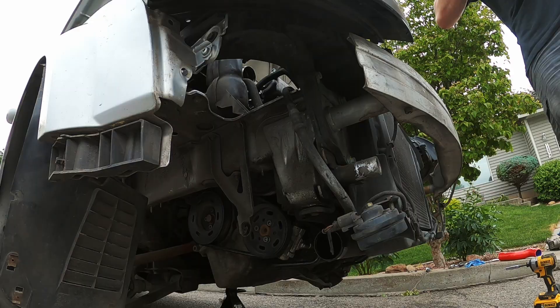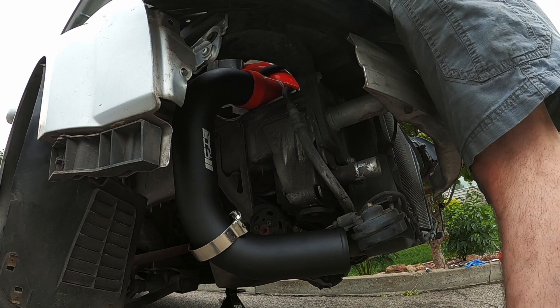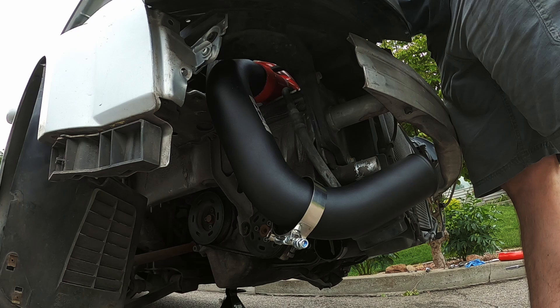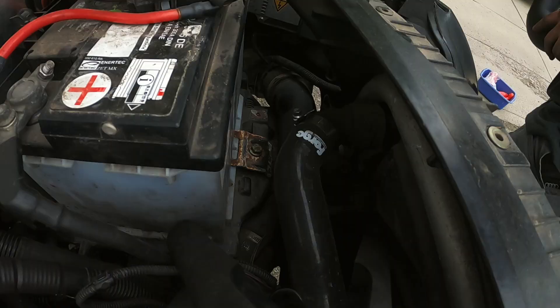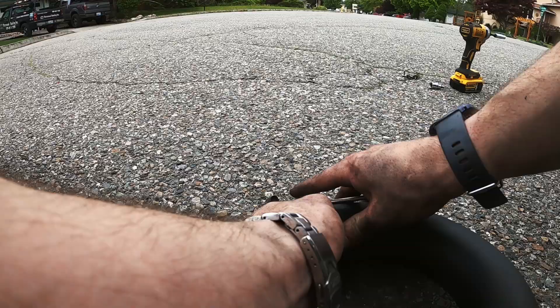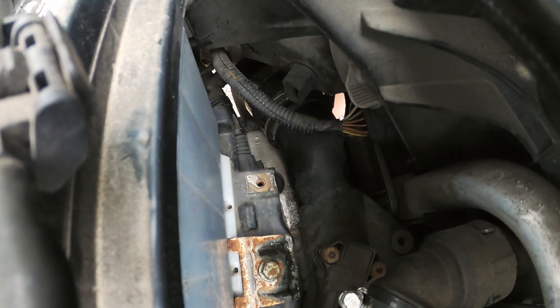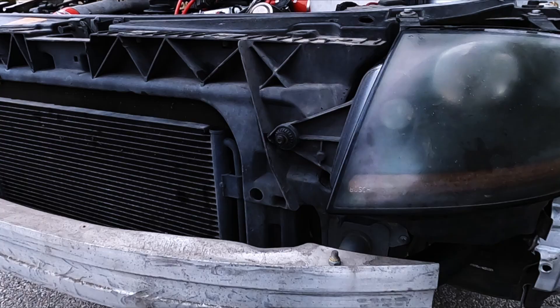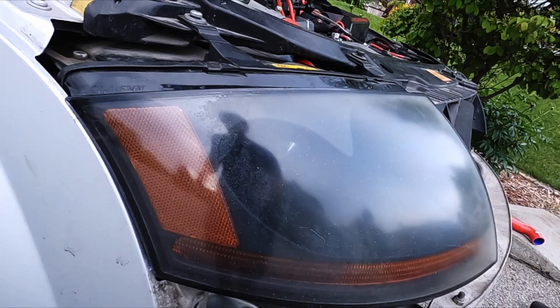I'm going to keep the metal pipe that's under the car because there are a lot of lines that bolt to it and it seems perfect for mounting. The intercooler piping that comes with this kit goes directly where the old intercoolers went. I installed the metal intercooler hose to the new silicone pipe outside of the car so that I had easier access to the hose clamp. My goal right now is to loosely install the pipes on both sides so I can start to test fit everything before I bolt everything down permanently. The metal intercooler pipes have a really snug fit onto the OEM pieces, so it was easier to remove the little rubber adapter between the MAP sensor and the intercooler piping and install it outside of the car. Some kits require you to remove the brakes and some of the other wiring and sensors, but this one fits perfectly without having to do that.